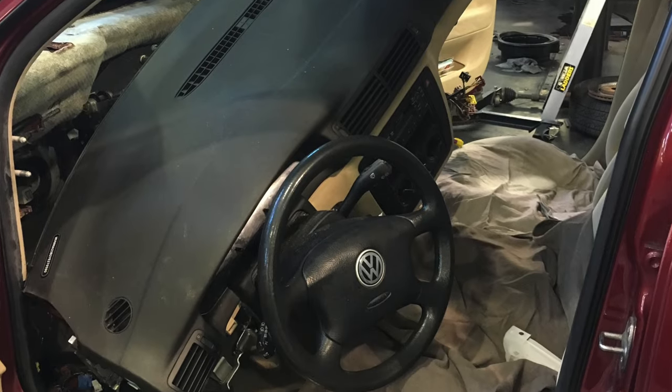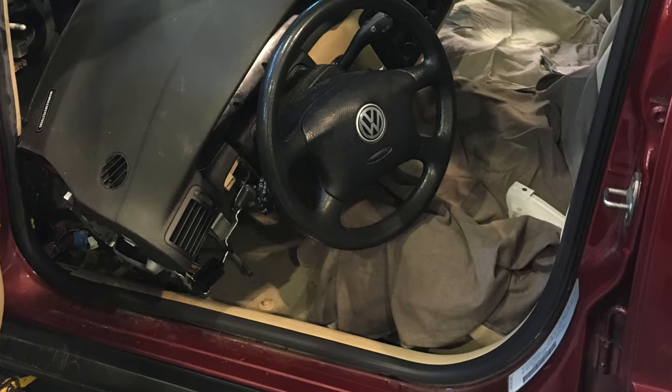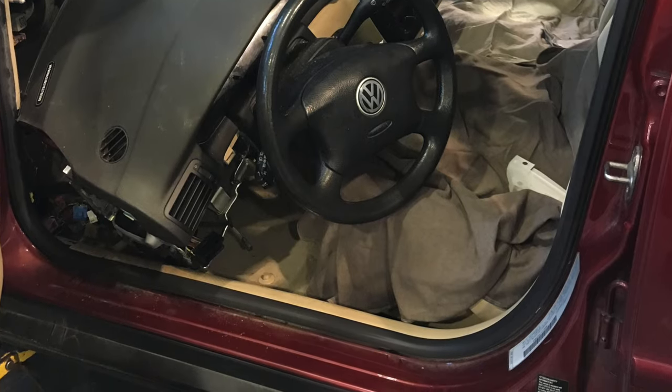You'll see here the way that we did it at the dealership. We pull the whole entire dash. We didn't take the entire dash apart. We just pulled the whole entire dash away from the firewall, from the bulkhead, and we're able to sneak the heater core in and out and do the repair that way, which is a great way to do it because